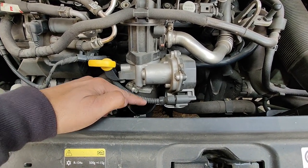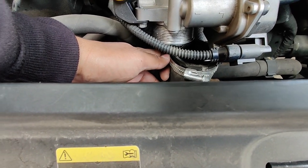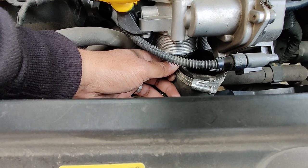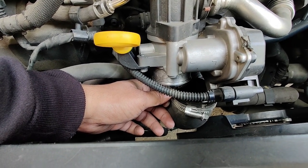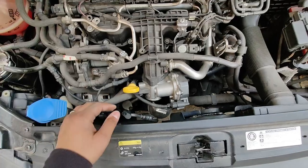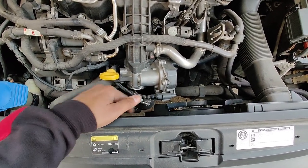I'm unbolting the hose clamp — it's a 7mm — and pulling the pipe backwards to create a little space. I've already disconnected the hose from the anti-shudder valve so we can hold the sprayer right here while the engine is running and spray the entire can in. Disclaimer: you may see white smoke from your exhaust — that's normal during intake and EGR cleanings. Also, check this area for any loose items, as the running engine will suck air in and anything loose could get pulled inside.